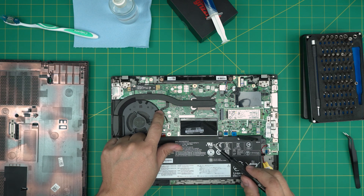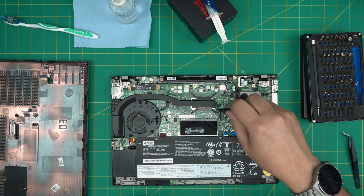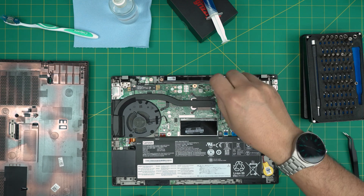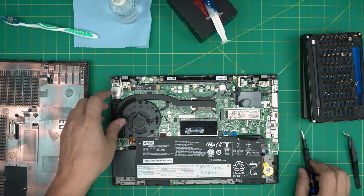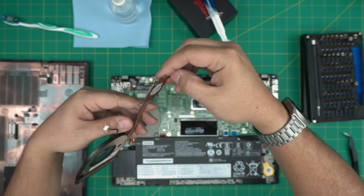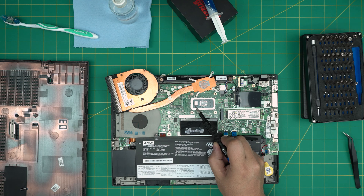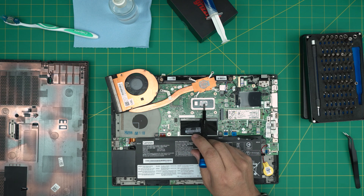Next, remove four screws on the CPU heatsink and one screw on the bridge in the middle. The screws have a C-lock so just loosen them up. Once loosened, grab the heatsink closer to the CPU — not from the edge — and bring it up. Right away we can see the underside. I notice this crystal die has no thermal paste on it, and there's space for it, but the factory didn't apply any. This is a PCH chip and it should be making contact with the heatsink, so we're going to apply thermal paste to it as well.